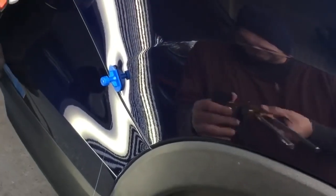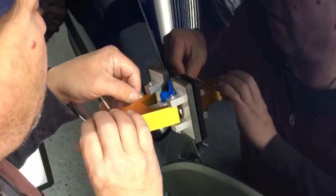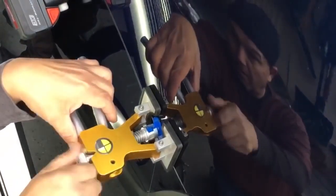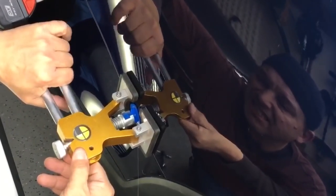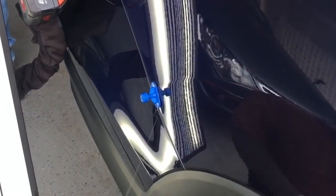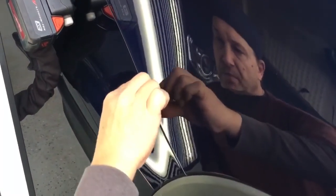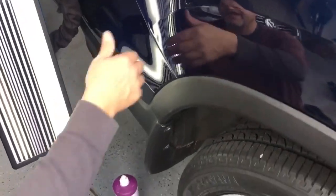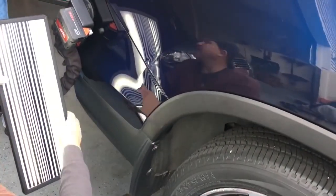Come through on this bottom edge — I didn't really push on it that hard, and I might even use the lifter. Come up underneath and cross this line. And if you notice, guys, I stopped pulling. A lot of that moved. So I didn't give it a full-on snap like I kind of wanted to, but you don't want to if you know it's going to pull high. I would rather take my time, make a couple more really nice proper pushes than give it a big yank and then spend the next 20 minutes beating it down. That's just a little experience life lesson.